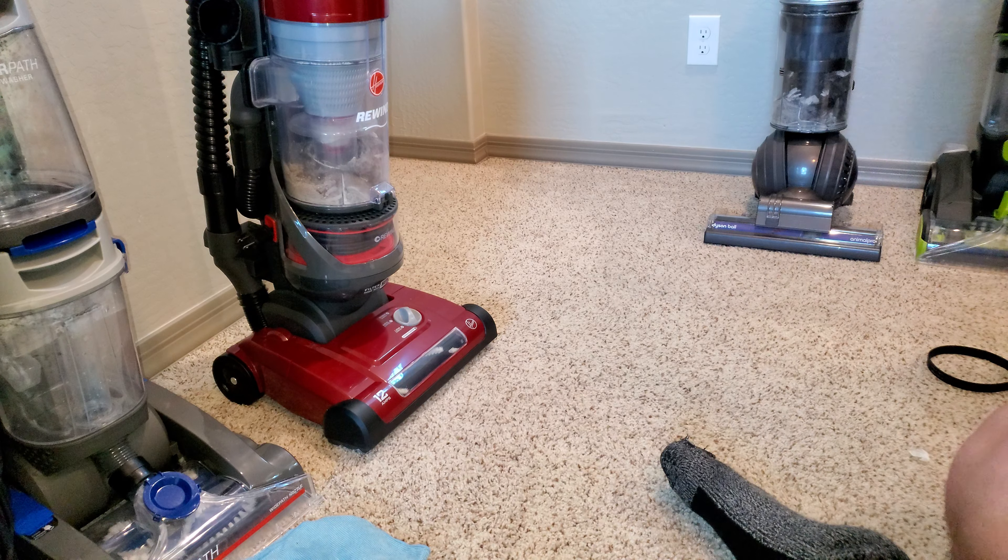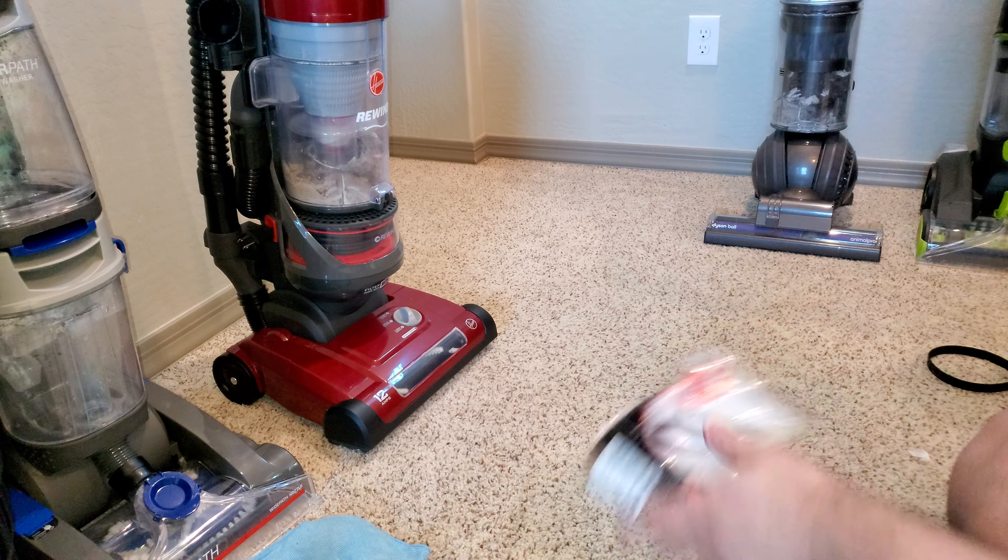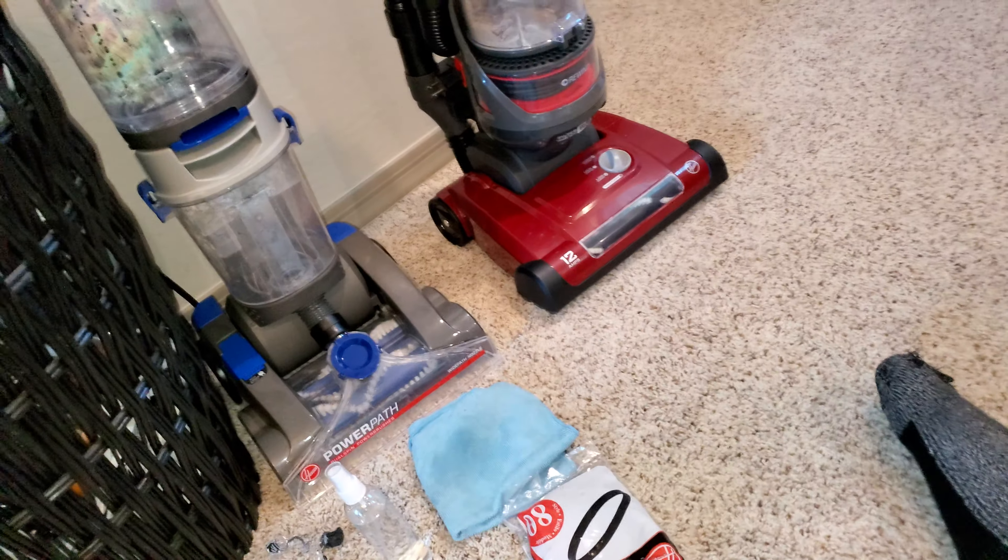Your machine is done — now it's ready to use again. Discard your old belt if it's worn, broken, or stretched. What you need to do is compare the size of the old one to the new one by putting them next to each other — if it's stretched by probably an inch, then dispose of it and put on a new belt. I hope you enjoyed that quick easy tutorial. I'll see you in the next one.